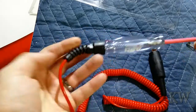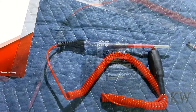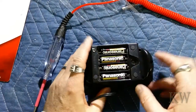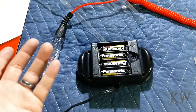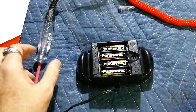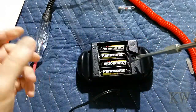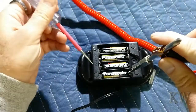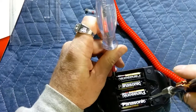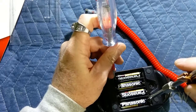Let me grab something we can do a little test on - we'll simulate a car. We're going to simulate six volts because that's what I could find. It said 12 volt is probably what you're going to be working on, but there could be other DC voltages - mostly 12 volt but you can have a six or 24 volt car. So if we put it on the negative and then the positive, you can see it kind of lights up right here by my finger. That's what it does - there's no beeping, just a little light to signal that you've got voltage.